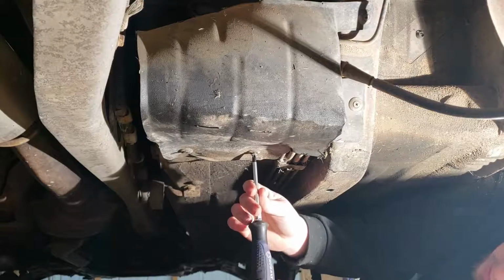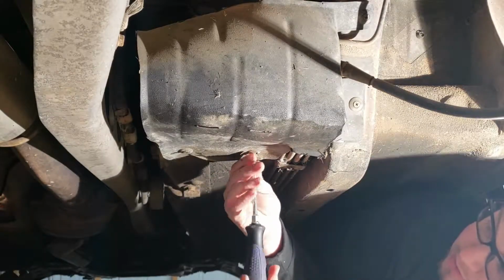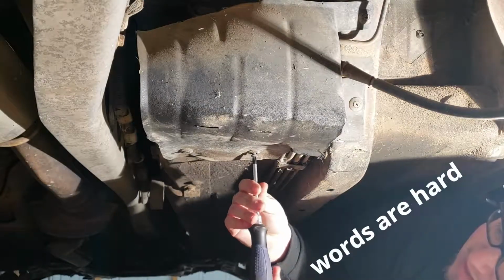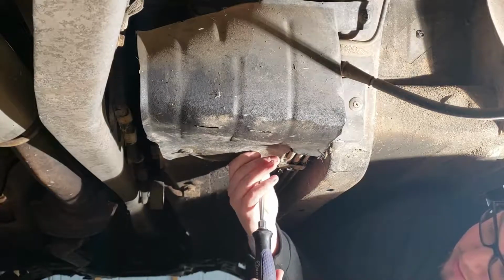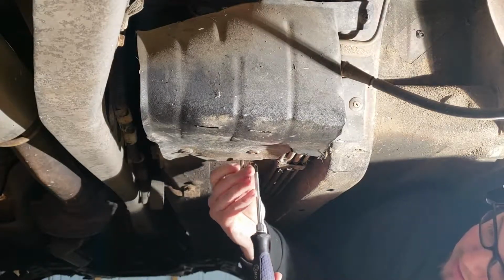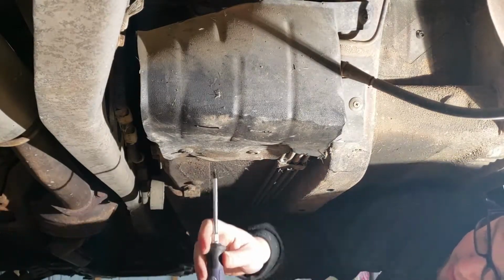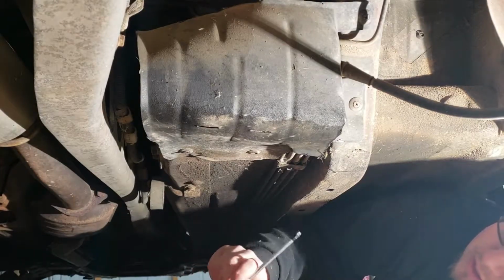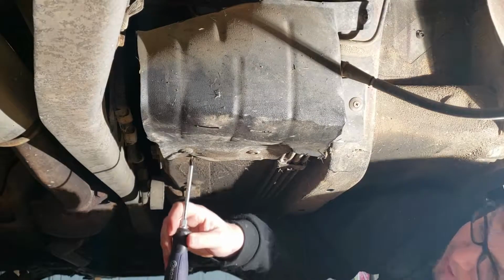Generally the best thing to do is just very lightly screw them out. It's a plastic screw that threads into a plastic clip, so the threads aren't very strong, and if you push on it too much as you're trying to unthread it, it has a tendency to just push the threads in, so it doesn't actually screw out, it just keeps pushing back in.